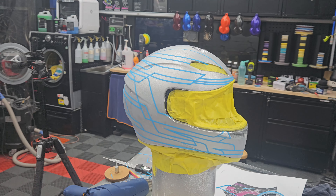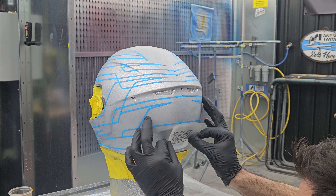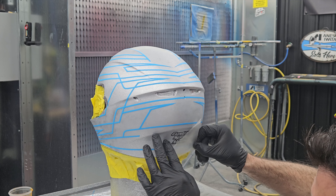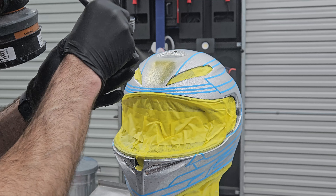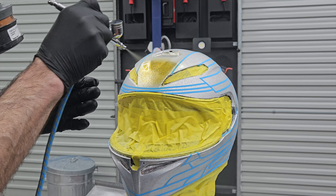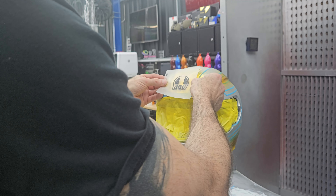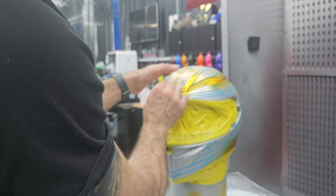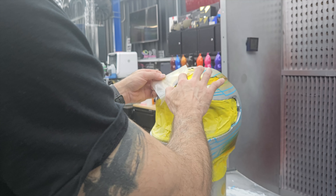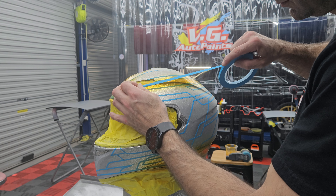Now I've finally got all the lines down the way I want it, and it's relatively equal on both sides. It's not perfect, but you never really look at both sides at the same time. I've also cut out some extra graphics that I'm going to lay down over the flake. On the front section, I'm spraying some gold candy because the image I want on top of this, I want it to be a gold candy color. Now I've got my sticker, and all I have to do is lay it over the dried base coat. I normally wait about 30 minutes before laying the stickers down — the base coat will handle it quite well.